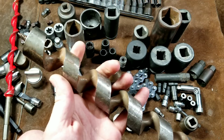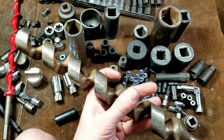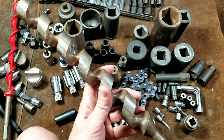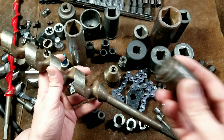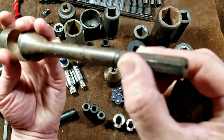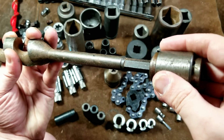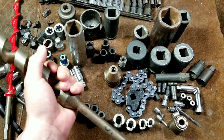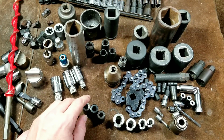And oftentimes you can reverse them out, but sometimes it just doesn't. Maybe the wood shifts a little bit because you drilled through some knots or something, and it's really caused it to bind up. And I've had these things really get so stuck, and this was the savior. I couldn't use an adjustable end wrench because the flats weren't wide enough just for the two flats of an adjustable end wrench. But with this socket, you could just put on the socket and use a big old breaker bar. Anyway, finally, we're done talking about specialty and unique sockets and random tools.